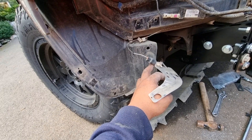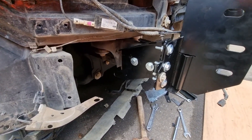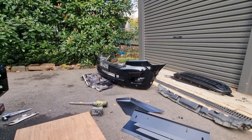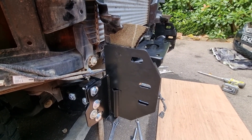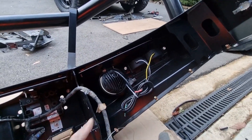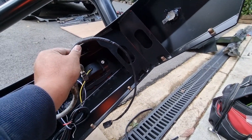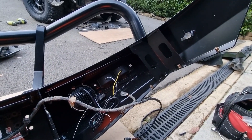Pulled the sensor off so it can be mounted back somewhere. Pretty much the same for the other side. Now we're up to getting the last bits of wiring out of that bumper cover and into the bull bar, then we can hook it on. Had to extend the loom by about 150mm on one side so it can sit nicely and reach all the sensors — and about 200mm on the other side, as 150 was a bit tight. After that, we can pretty much bolt it on — let's do it.